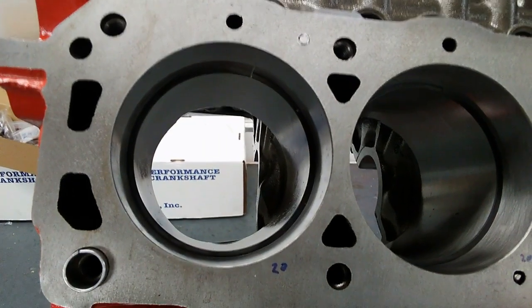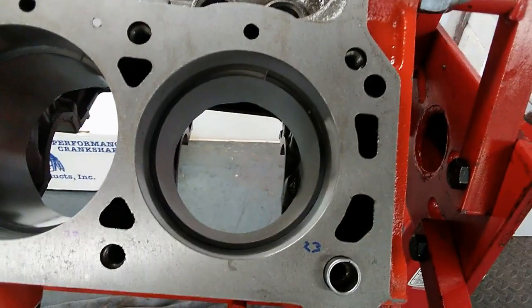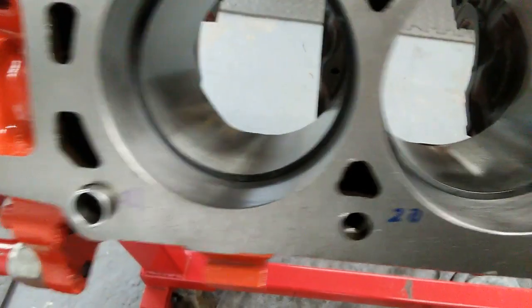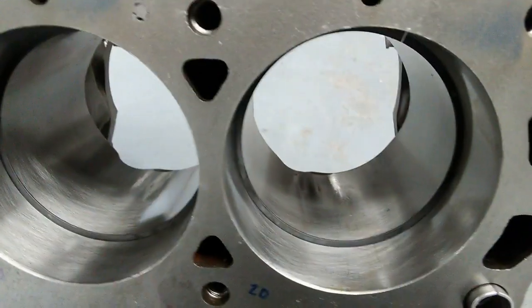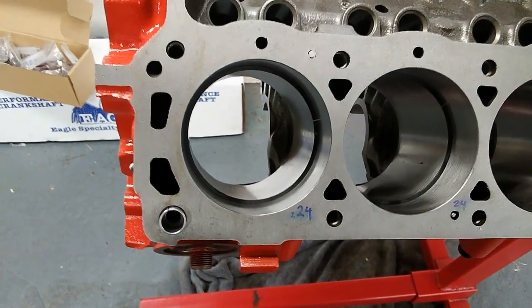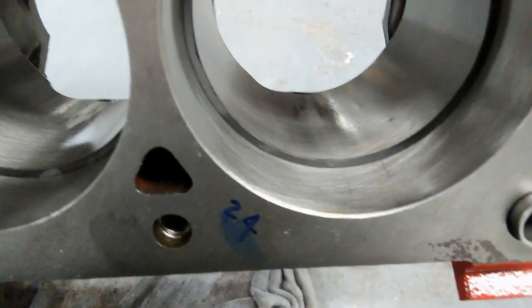My top rings are done: I've got 20, 20, 20, 20 — went a bit far with one at 23 — and over here I've got 21, 20, 20, and 20, so more than happy with that. Now doing the second ring: I've got 24, 24, 24, 24, went a bit far on one at 26, and then 24, 25, and 24, and we're looking for 24.